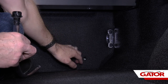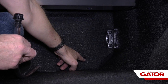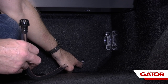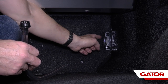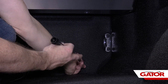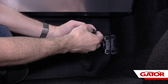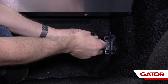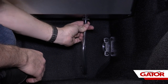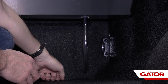On this particular truck on the bulkhead, there's an oval plastic kick-out that sits right here — I've already popped that out and drilled a little hole in the bed tread so I can route the drain tube out. If you have a spray-in bed liner, just drill a hole right through the plastic kick-out. If you have a drop-in bed liner, a lot of times you can just drop the drain tube right through the hole that gives you access to your front tie-down hook. I'm just going to feed this drain tube right through, take my washer and fit that around the part that pops into the canister. I've also already pulled off the protectant film that sits on top of the canister — you want to do that first. Fit it right into the hole — you'll hear it click twice and that way it's installed. Do that on both sides.